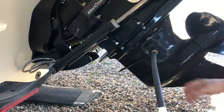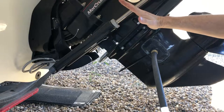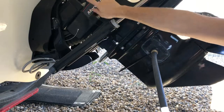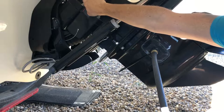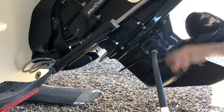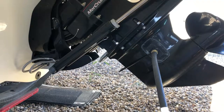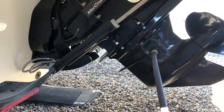When you go to change the oil, you're going to want to set your trim so it's level. There's an air vent there and the drain is down on the other side — you drain all that oil. Then you can top it up, that way you're not carrying any moisture that might already be in there through the winter, which could freeze.